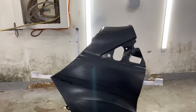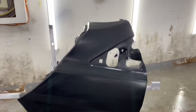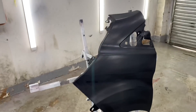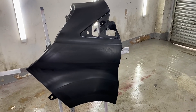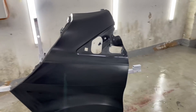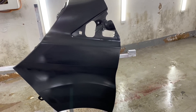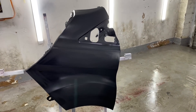There we go. As you just saw, I haven't gone mental with the 500 soft pad - just give it a good key all around all the areas that I'll be painting. On the edges I've just been a bit careful because you can buzz through. I'll give it a wipe down - some people would go straight to the next grit straight away. I've cleaned it down - I like to keep the panels as clean as possible because most of the dirt in your jobs is what's left on the panel rather than what's falling onto it from the air.